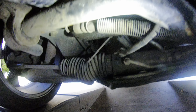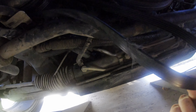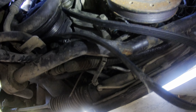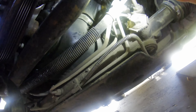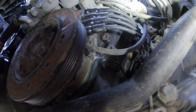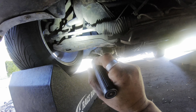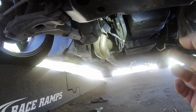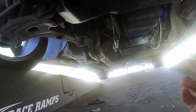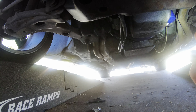It didn't look like it was rubbing or anything. It seems kind of a smart way to do it. It looks like this belt's kind of missing a groove there - I wonder if that hub is off center or something. I'll look at it later. All the new ones are on there, got them nice and wire-tucked. I want to tuck it a little bit more back there with a zip tie. All the plugs still look black. They had some iridiums, some AC Delco regulars, and some AC Delco platinums - kind of a mismatched hodgepodge deal. I don't see a trans leak really - I think it was probably just from sitting. I see it kind of wet back there but it's not really major. I'm going to double-check it though just to make sure, because I don't want to be losing fluid. It might be the pan gasket. It doesn't look like it's coming from the top, looks like it's coming from the pan. When transmissions sit a while they start leaking a little bit.